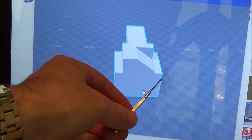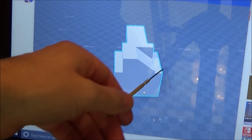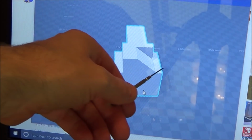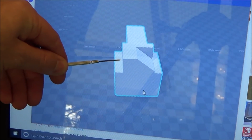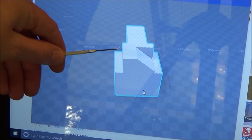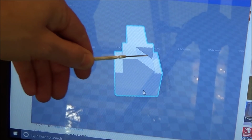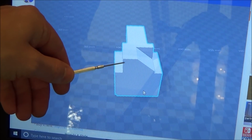And what happens is, when you're putting the JoyCon on, it's nice because the rails, these little rails here at the side, hit up against this and push over this ramp nicely. But then when it comes to the other side, it should stop dead against this. But what happens is, when it gets chipped, like you've seen on my one, the metal rails just bounce over this and push this down. So it's kind of like having a ramp on both sides because it's chipped.